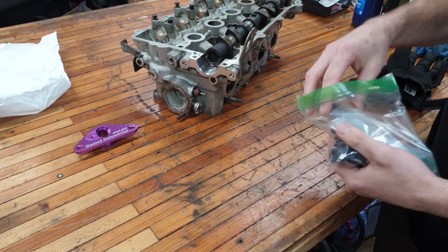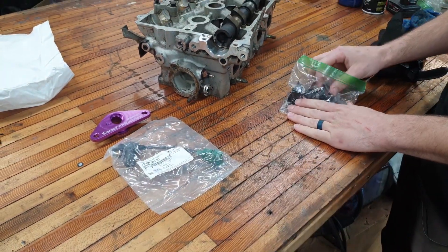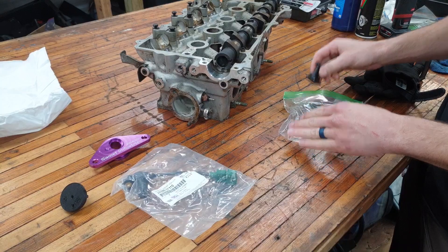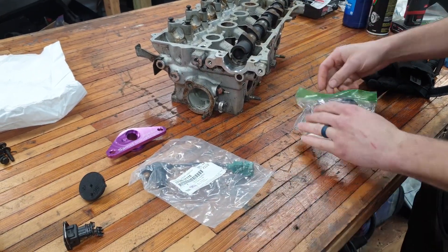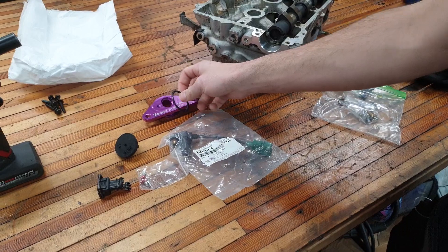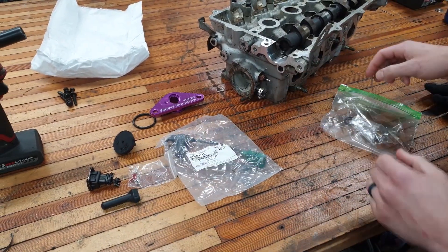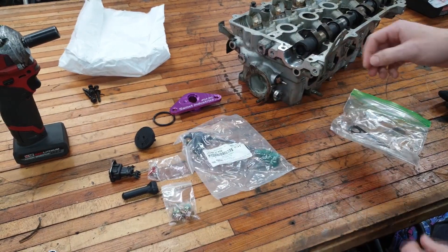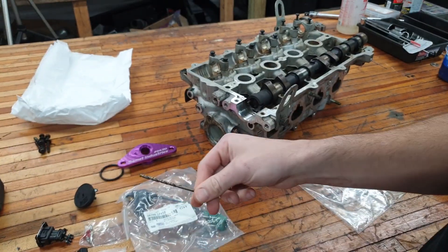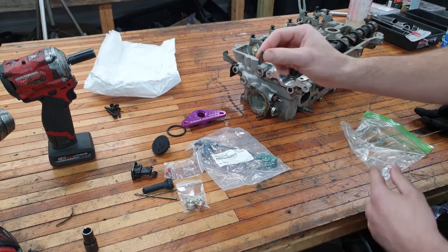If you're ordering starting from now, you will receive a gray one. You will get a brand new OEM Kia sensor, one installation guide tool - a little 3D printed plastic bit. It'll come with everything you need to do the wiring for the kit: one improved quick connect connector, three pins with pins and seals to keep it as a sealed connector, a Viton upgraded O-ring - the same O-ring you'll find on your distributor or CAS but a nicer material. You'll have a boot for your wiring harness, hardware for the kit, a dowel pin, and a drill bit - a very special sized number 23 cobalt bit just for this dowel pin. For those who ordered the first 20 edition kit, you'll have another O-ring in the kit - later kits will not come with this.